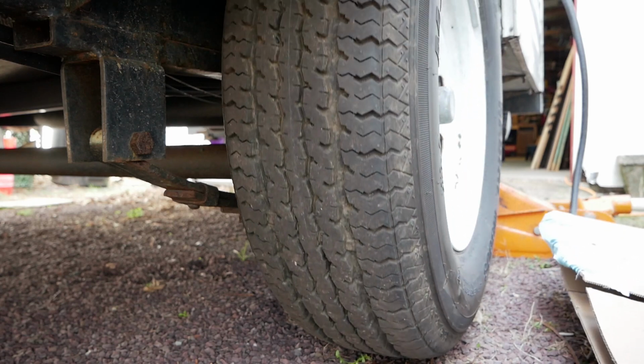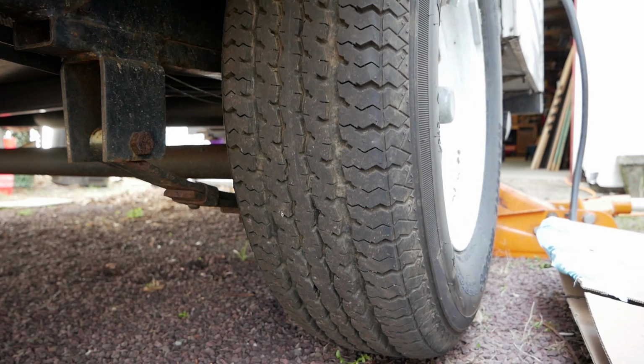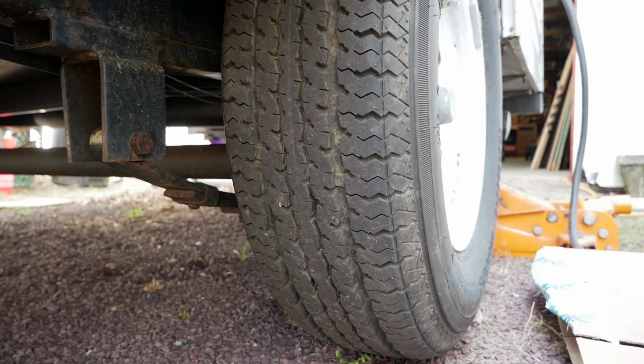And I got a problem. Okay guys, we're going to have to look at this for a minute. It's obvious we have a problem. So I then put the pin back in the breakaway switch before plugging the camper into the back of the pickup truck. I do this because I don't want to run the risk of blowing any fuses in the truck if there is in fact a short somewhere in the trailer braking system.